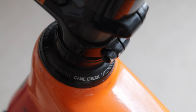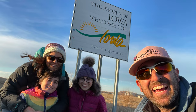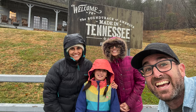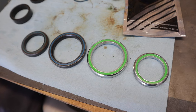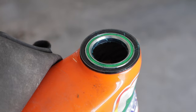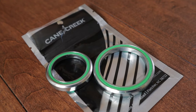I've had Sonny for over four years and hadn't needed to touch the Cane Creek 40 headset beyond routine cleaning and greasing. It's been absolutely bomber over thousands and thousands of miles. But I recently road-tripped across the country with my family, hit some horrendous rainstorms, and then lived near the beach in Wilmington, North Carolina for a few months. Some water got in and the salty environment didn't help — I started noticing friction. By the time I got home to Idaho it was pretty much seized, the bearings too far gone to flush and re-grease. New headset bearings for 30 bucks and she's back to being smooth as a baby's butt.